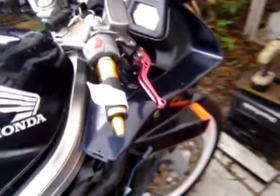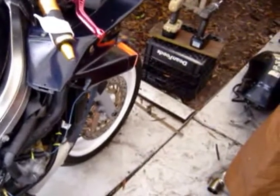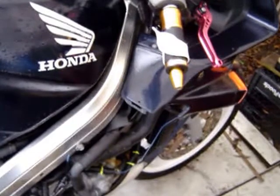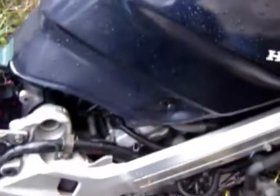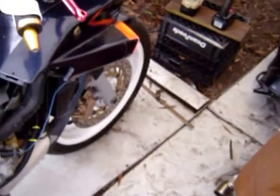So if you run into this, you've got a vacuum problem. Now, to alleviate it, fuel's just going to get spit out. But I had it on the other one too, and I couldn't figure out what was going on. It's because no vacuum is in there, or there's a vacuum leak. So in order to fix that, once you start seeing fuel kicking out, turn it off, give it a couple cranks, spit everything out like your carb cleaner and all that, and it should be running good.